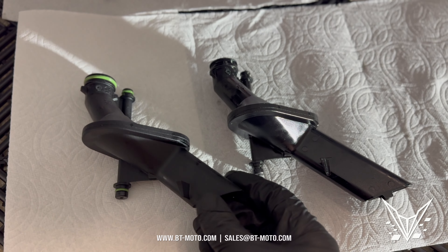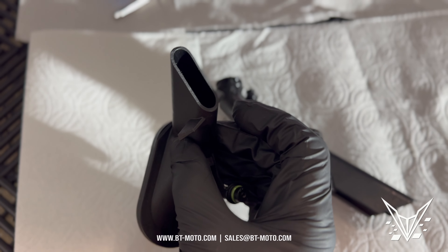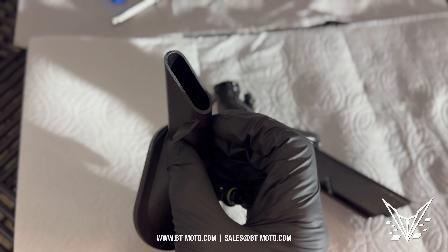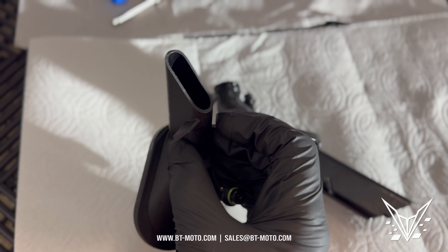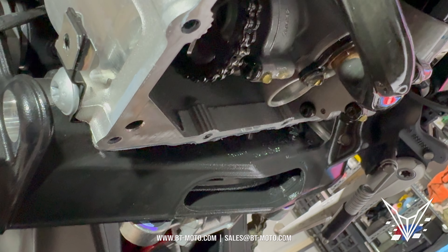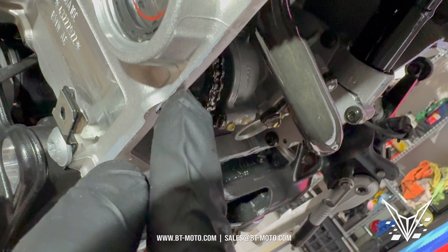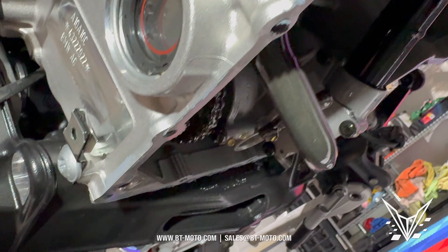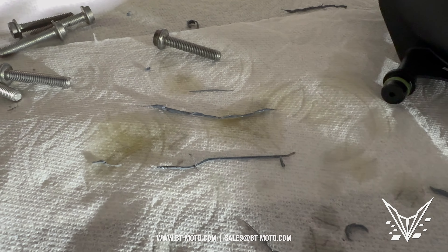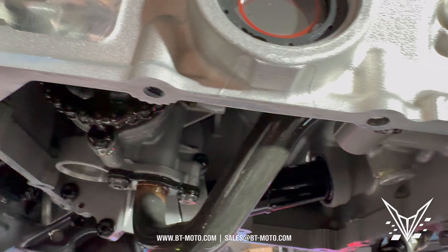Now that you've got your new lower-profile pickup ready to go, make sure you've cleaned up any rough edges so it's not picking up debris through the tube. Use something like a Dremel or a file to knock off all those plastic edges. If you cut it nice and clean, you're good. Next, a little bit of housekeeping — under the bike you can see there's still a little bit of RTV here and there. Take a razor blade, be nice and careful, and gently pull all that old RTV off to make a nice clean edge and surface, then wipe it off with a towel.